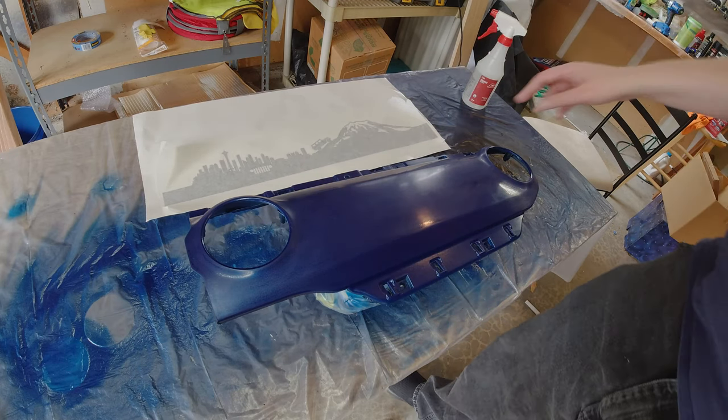You may have a few air or water bubbles, but it's easy to push them out to the closest edge. I also found out later that using paper transfer tape is better when doing the wet apply than the clear stuff.